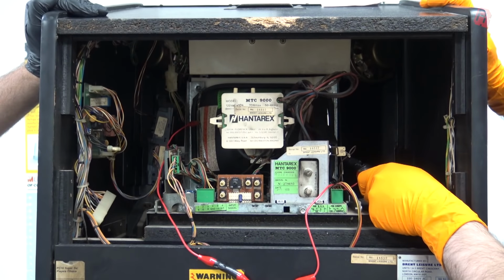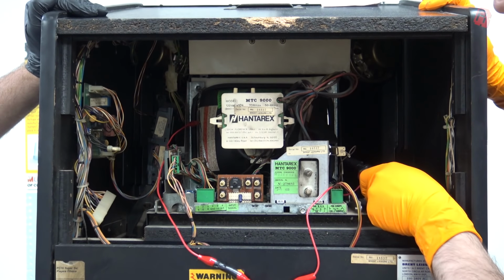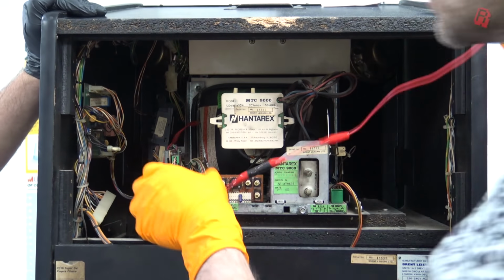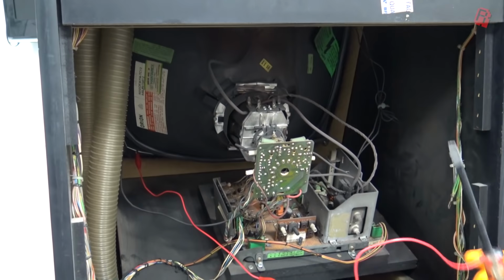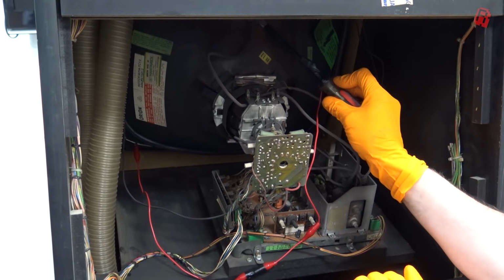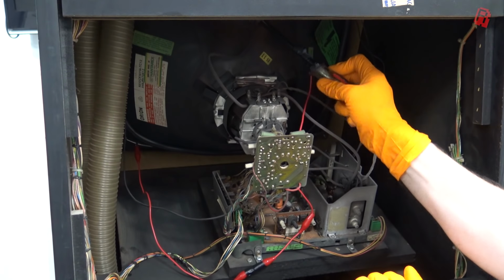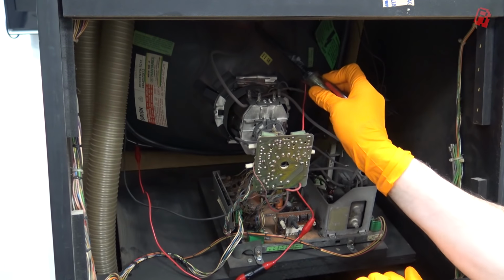So before doing anything further, we went with the old screwdriver connected to the chassis discharge method, slipping it under the anode cap to safely discharge it without any dramatic cracks or snaps on this occasion. Caution is still advised at this point though, because yes, the screen can act as an almighty capacitor and shock you, but there's also some large capacitors on the board itself, so once again, do be careful. Which I think I've said enough now, so if you stick your hand in places you shouldn't after this point, well, I did tell you so.